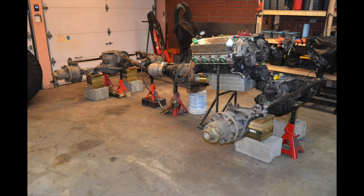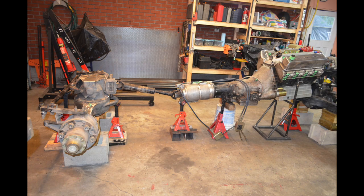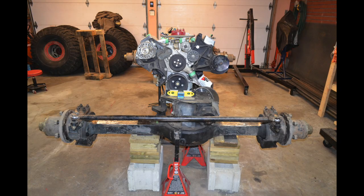As you can see in the picture, I set the engine so the crankshaft pulley is as far forward as possible. I set the drivetrain as a whole thinking about the buggy in compression — I want the engine and whole drivetrain as low as possible to the ground. I was aiming for about 20 to 22 inches of belly height, meaning the lowest point of my drivetrain — which turns out to be the back of the transfer case — is approximately 24 to 25 inches above the ground. The angle of the engine front-to-back and side-to-side is not critical; it depends on the angle of the drive shafts.